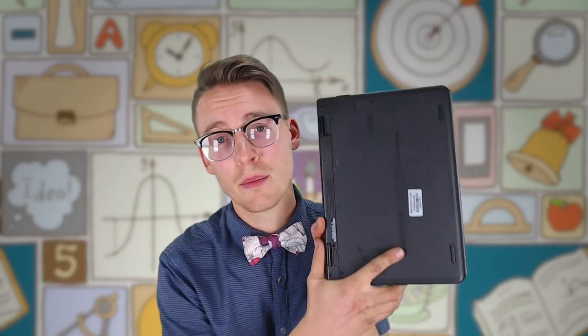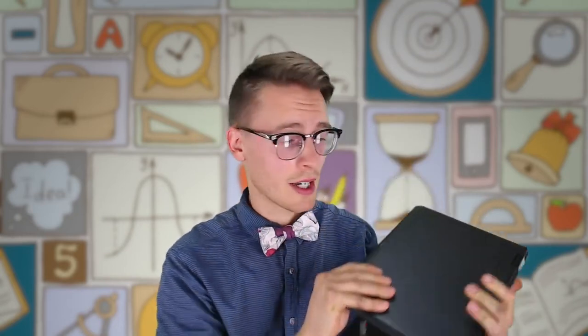If the display is working but the backlight is not, you should still be able to see it get darker and lighter. Once you have identified whether it is the backlight or not, what can you do about it? Well, that ultimately comes down to taking the back off or taking this display area screen part apart. You really can do it — I would highly recommend you look up a YouTube video on how to do it so you don't break the little plastic and find all the hidden screws. In that case, it's an issue of disconnecting and reconnecting some connector that has probably come undone or has just broken contact with its mate connector.